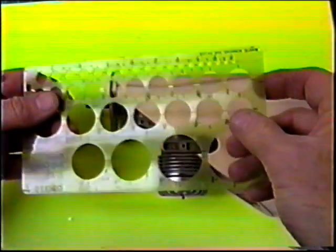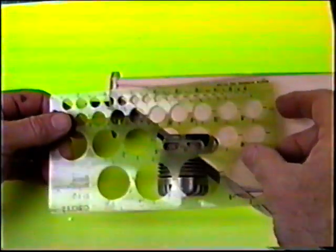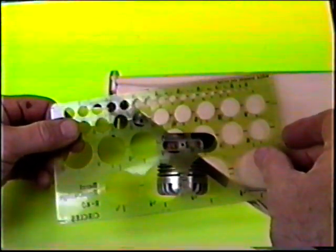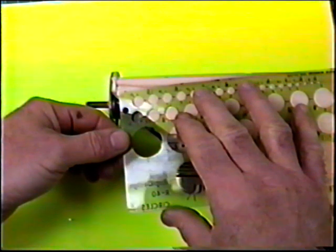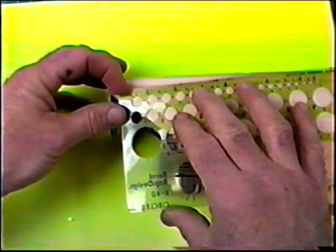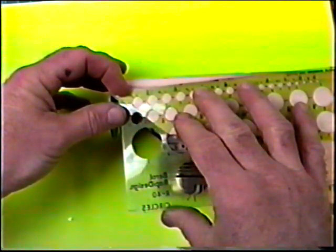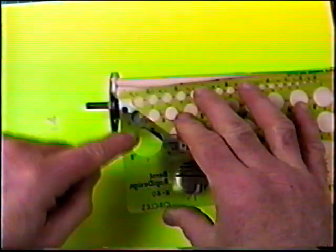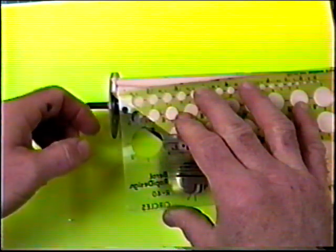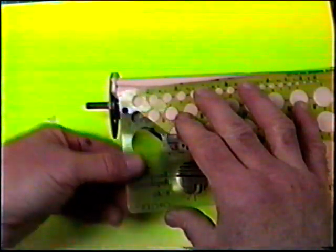Okay, now President Nixon will help me cut this needle valve hole here. See, what I try to do is lay this right out, using a hole that's definitely a little bit bigger than I think I need, because I really don't want to take a chance. The minute you move the motor or switch from one motor to another, those needle valve holes could be off a couple of thousandths. I need to plot this out.